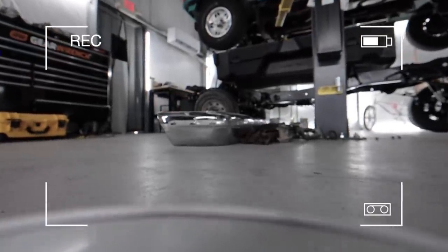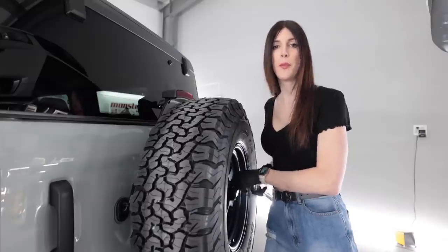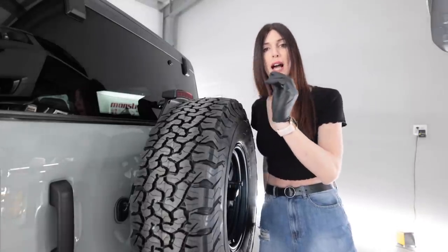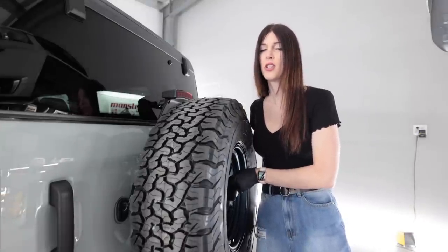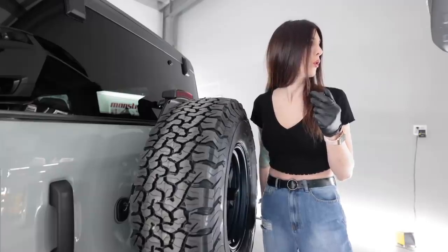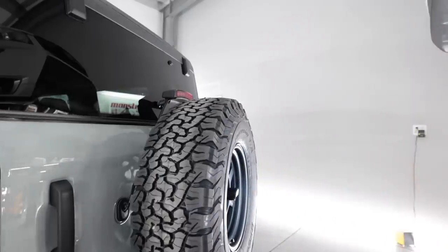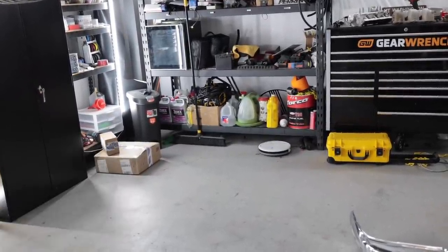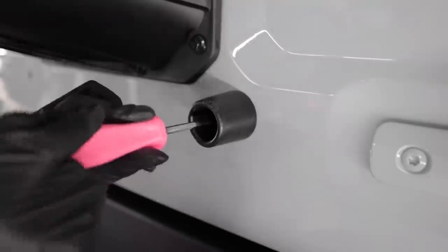It's the next day — I got all of the paint polished out with the exception of the rear door; it's almost ready for ceramic coating. I changed things up right after I did the first panel yesterday and switched to the blue polishing pad — it's a little bit finer, because the black one was just leaving a faint haze on the paint, which is a little too aggressive. But the blue one did the job. I'm going to take these things off just to make it easier to polish.